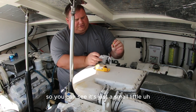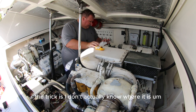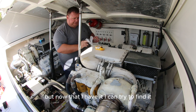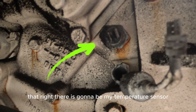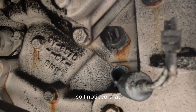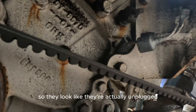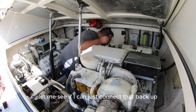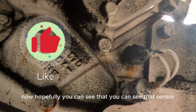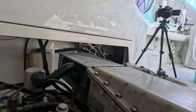You can see it's just a small little sender. The trick is I don't actually know where it is on the engine, but now that I have it I can try to find it. I think I found it — that right there is going to be my temperature sensor. I noticed that both of the wires look like they're unplugged, which is 100% why it's not working. Let me see if I can get a better angle. So they are unplugged — I'm going to connect that back up and we should be good.